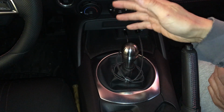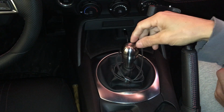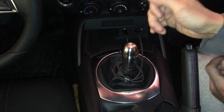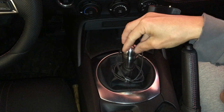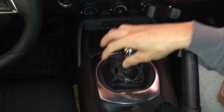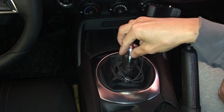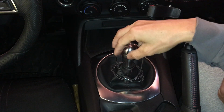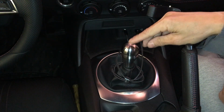So when I did that, it kind of made the steering wheel a little bit firmer. But also I got wider tires. When you get wider tires, it also makes your steering feel firmer as well. So in that regard, the stock shifter felt a little bit too soft, and the steering felt firmer, and it threw it off balance. And also putting this on, it took a little bit more effort to shift now, and that made it more in balance with the steering wheel.